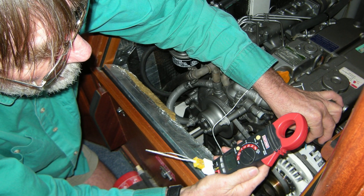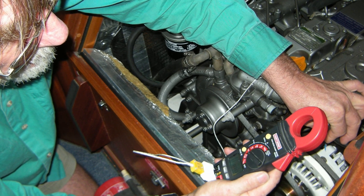Which should be the case anyway, if you want to run the alternator at its maximum output. The last thing you want is a fuse close to the alternator, because when a high output alternator is running hard, the temperature on the case can be well over 100 degrees centigrade — 212 Fahrenheit. Because the fuse is a thermal device, if it gets hot, it might melt the fuse even though there's no over-current, and then you destroy the alternator. So, there's really no way you want to have over-current protection at the alternator, although technically speaking the ISO standards currently require it if the alternator is wired to any other point other than the solenoid.